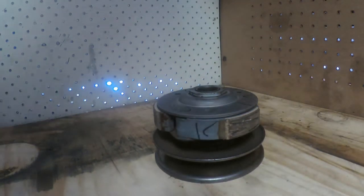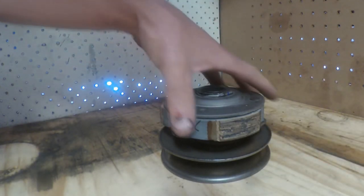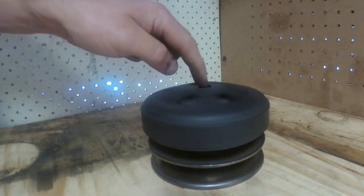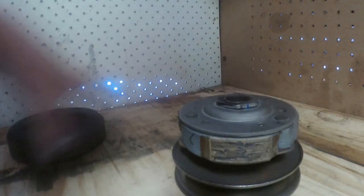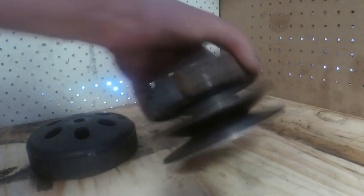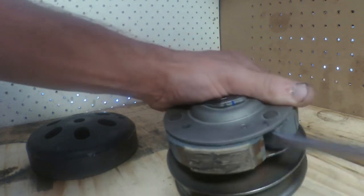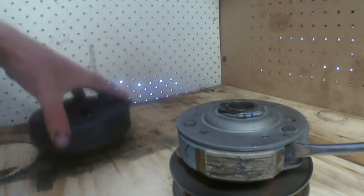The clutch is a pretty simple system as well. This one has three — they're sort of like brake shoes. The way they work is this part is connected, as I said previously, to the rear wheel. So what these have to do — same thing with centrifugal force — is throw out and grab the surface to turn that. They've got little springs in here, and these springs with centrifugal force throw out. And that's all it takes, because it just has to go out and grab that to make the rear wheel turn.